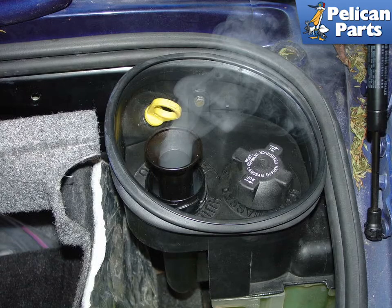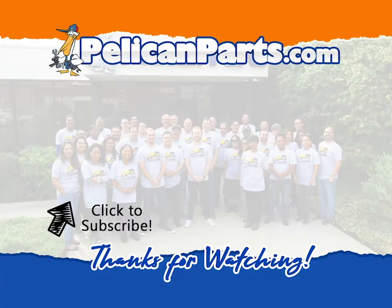With the system pressurized, you can check to see if your engine is fully smoked out by removing the oil filler cap. A steady stream of smoke should exit the filler hole. This means that smoke is going from the intake through the air oil separator and into the crankcase. At this point, replace the cap and carefully examine your intake for smoke trails that will indicate vacuum leaks.